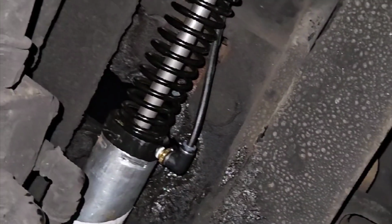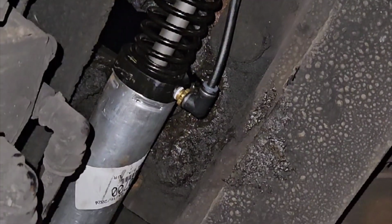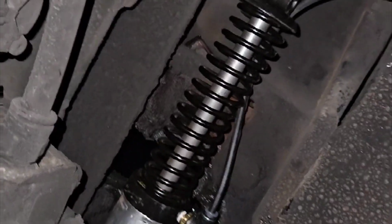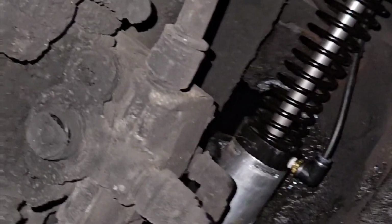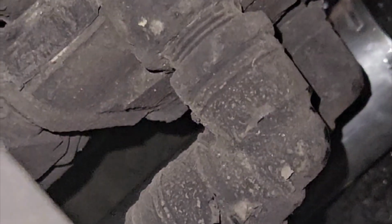So I am up under the truck looking at it from underneath. As you can see, you've got a bolt here, and you've got another one right there. And you do have to compress this by pulling it back to slide it over the yoke or fork or whatever that is that holds the fifth wheel in place. You can do it with one hand, and then you just connect your airline here, as you can see, and it fits together the way all other airlines fit. Just press it and then pull on it to make sure it's locked. And now we're going to go and see if it's working.